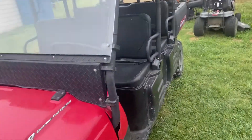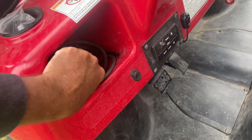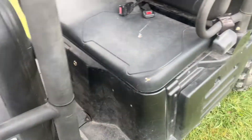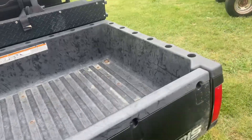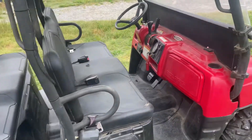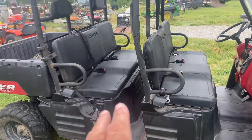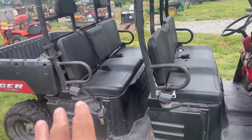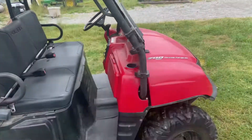So what was going on with this - it sounds pretty good right now. He replaced the coil pack, something else, and some plug wires. The throttle cable on this is kind of squirrely; it gets out of adjustment pretty easy. But it was cutting out on me and I think the coil pack was bad because when it got hot it was cutting out on me. It'd start back up, but it'd cut out, and when it was cold it would run good.